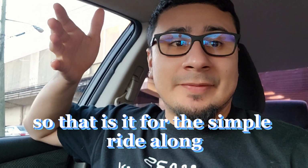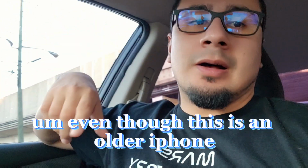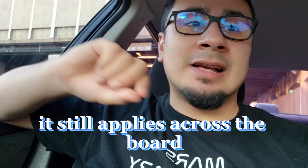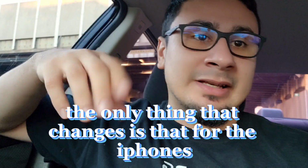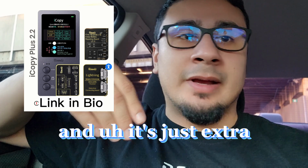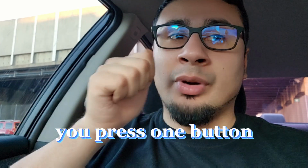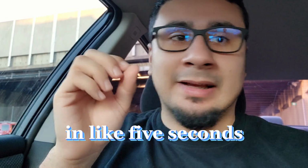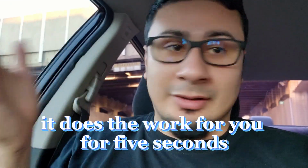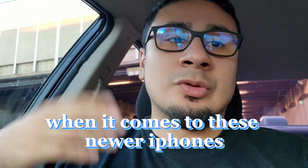All right, guys, so that is it for the simple ride along for iPhone repairs that are mobile. Even though this is an older iPhone, an iPhone 6s, it still applies across the board. The only thing that changes is that for the iPhones 8 and up, you need a programmer, and it's just an extra step that you got to take. You connect the old screen to the programmer, you press one button, it does the work for you in like 5 seconds. You unplug it, you connect the new screen, you press another button, it does the work for you for 5 seconds, and that's it. That is the only extra step that you have when it comes to these newer iPhones.